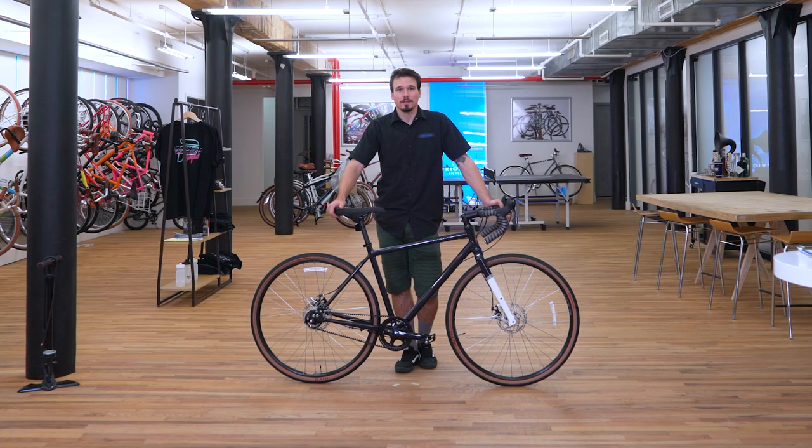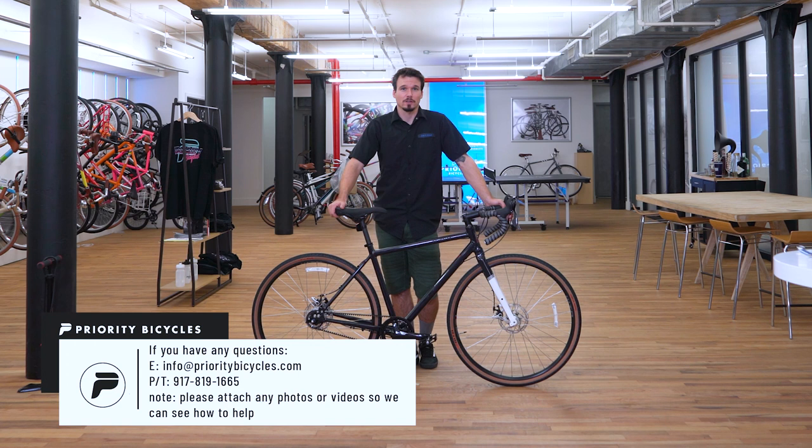After going through the bolts of the bike, we recommend having the bike checked by a professional mechanic. This is especially true for the wheels as they are often de-tensioned in shipping. It's also important to recheck the spoke tension after the 100 to 200 mile break-in period of the wheels. We also recommend having the wheels and brakes periodically checked every thousand miles or so through the life of the bike.